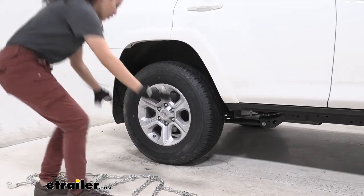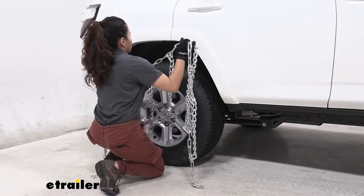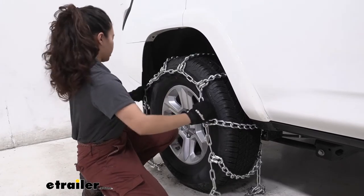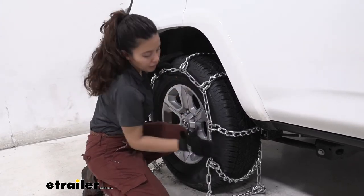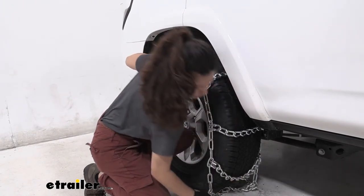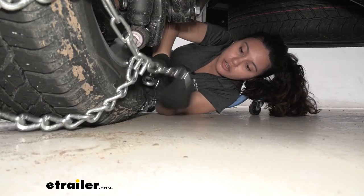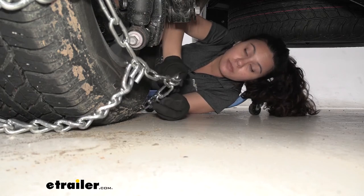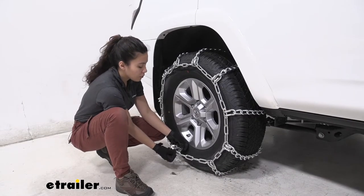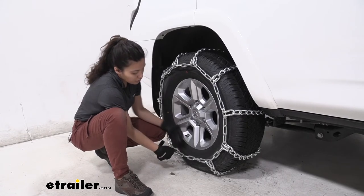What I do when it all looks good is just grab it from the middle, lift it up, and then drape it over your tire. Try to get your chains as evenly distributed around your tire and once that's done get the end and throw it behind your tire because you're going to have to connect it. Once you're behind your tire you're going to connect the hook with the links in the back and just make sure that your hook is facing away from your tire. With your back ends installed you then bring it to the front and connect your large hook with the other length of chain.